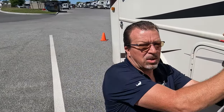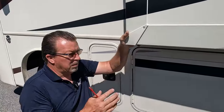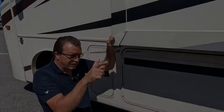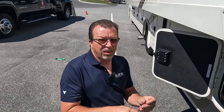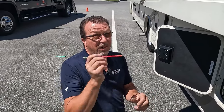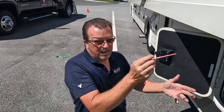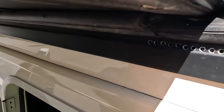So I had water in there. Now I'm checking the floor of the slide out — remember this, because the slide out floor goes inside the coach. I'm getting a moisture reading of about 57% on this end. Same thing at the other end — if you're gonna try to screw the system, some things are pretty obvious. There's a reason why people drill little holes. We saw that on a Class C before in the front end — and same here at the back.